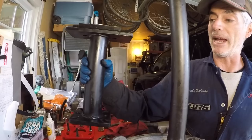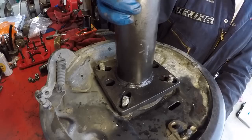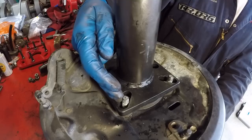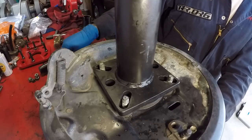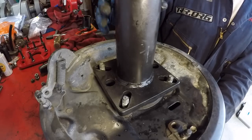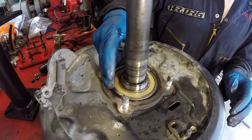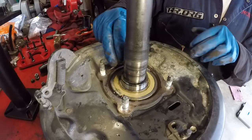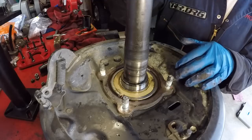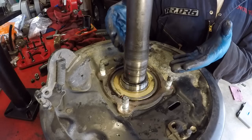Now take the main tool and slide it over the axle shaft. You might notice when you first slide the tool over, you're not seeing quite enough threads for a good bite with the nuts and washer. That's because when you pounded out that stud, the bearing slid in the bearing case — this bearing is not a press fit in the case. There's an easy fix for this.